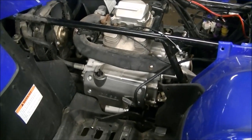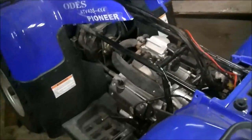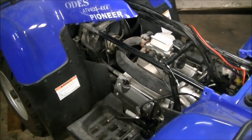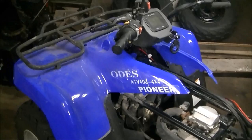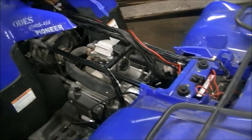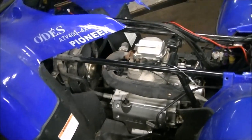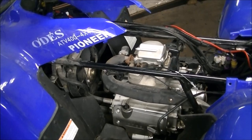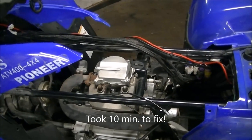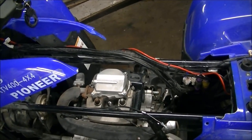I just wanted to show you this and let you know — these aren't bad little ATVs. If you maintain them well, I don't think they're much different than a Honda. This is a 2006 with a thousand miles on it, and I'm guessing it wasn't maintained very well. So I actually fixed it — I took the valve cover off and I noticed the gap between the rockers and the valves were almost twenty thousandths of an inch.